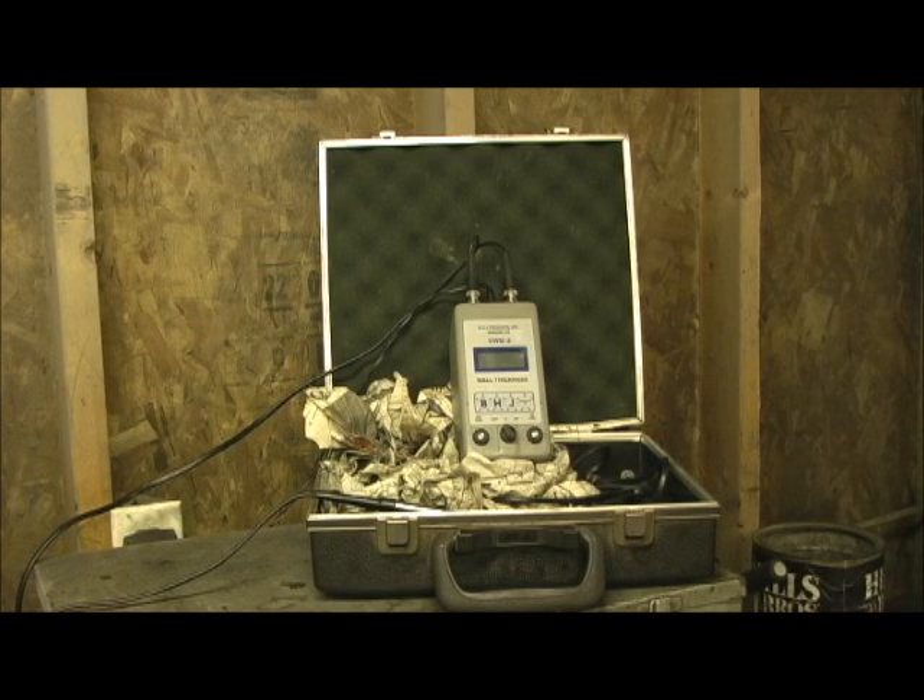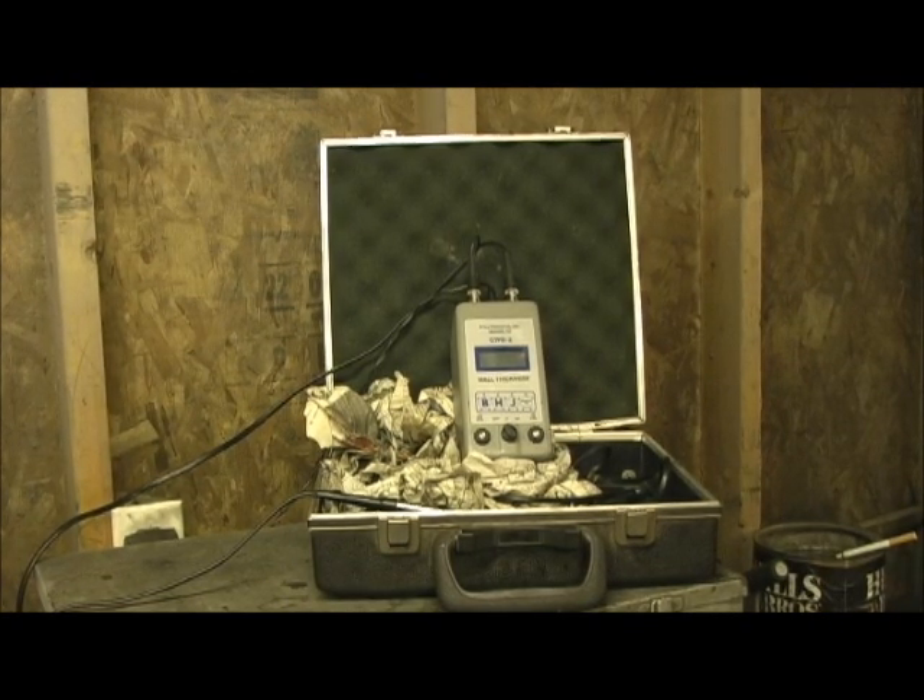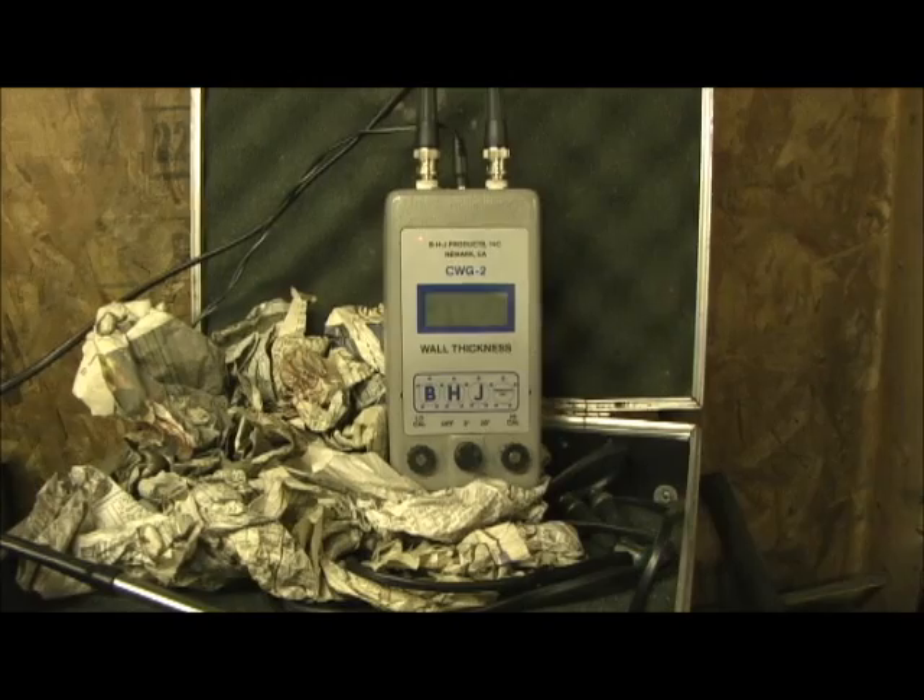If you go to a cylinder head shop that claims to be professionals at porting heads — not a shop that says they can just clean the bowls up and gasket match it — that isn't nothing, and usually you get nothing out of it because they didn't go in there and really grind the meat. They just knock the sharp edges off and make it look pretty. As an old mentor of mine, Jerry Goodell, once said: 90% of this is cosmetic. When it's shiny, they reach in their pockets. Let's get a look at the main tool that a cylinder head shop has to have to claim to be a porting service.